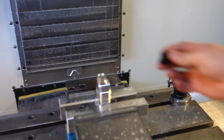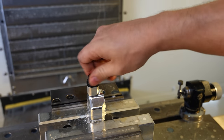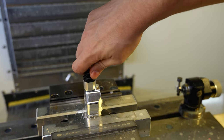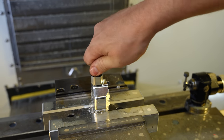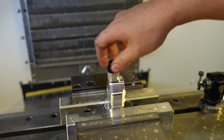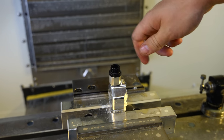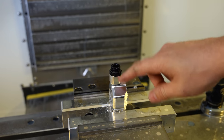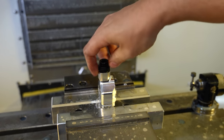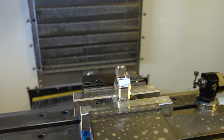Let's see if just one pass with the threads is enough. It was. Look at that. You can see the O-ring catches not the last second, but like the last half turn — almost a full turn. It's getting pressed, but not crushed. That's a big difference. The O-ring is now holding the liquid seal between these two, but the threads are holding the structural seal. All that done in one run, and we have some of the most perfect-looking threads I've ever seen.